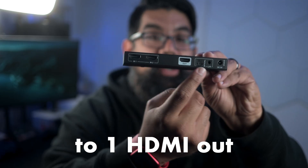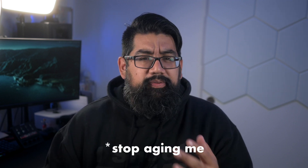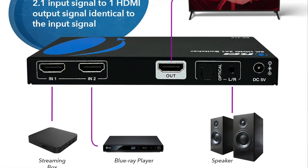Let's get into the details about this device. It actually has two HDMI in ports and one HDMI out, but you're going to notice something different here which is not included in something like this cheaper switch — it actually has an audio extractor. If you've ever played a PS4 or an Xbox 360, you knew there was a thing called an optical audio out or digital audio out. The idea is you could split your audio track from your HDMI cord and take it to a speaker system or stereo system in your house. So if you have a 5.1 surround sound system, you could run that audio directly to the system. Not all audio systems accept HDMI, so including this optical audio out or digital audio out is huge. If you have a DAC for headphones, you could run an optical cable from here into your DAC, or run an analog stereo cord from here into your speakers.